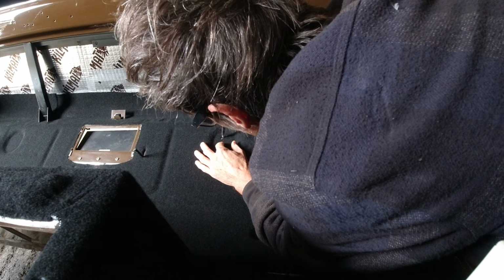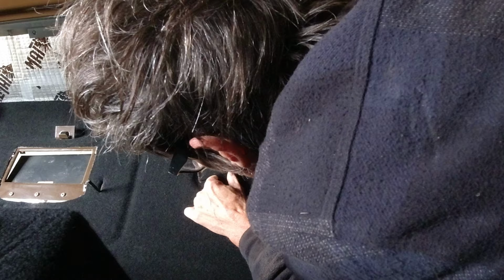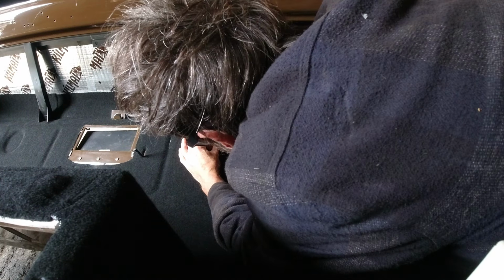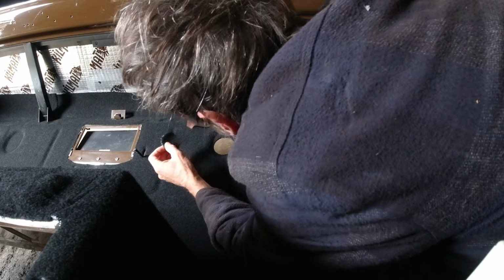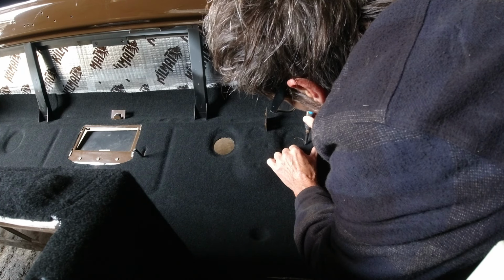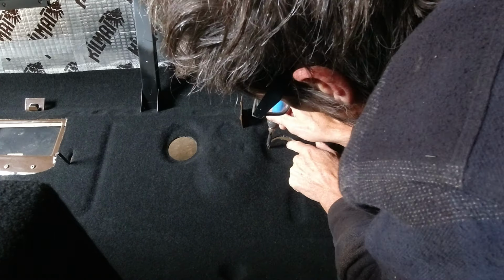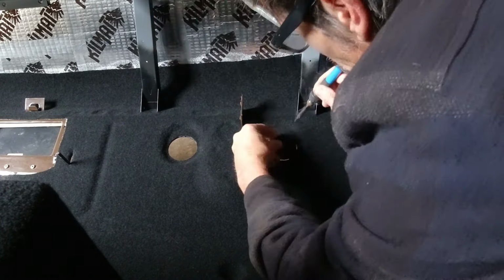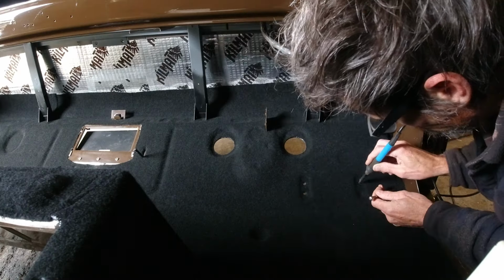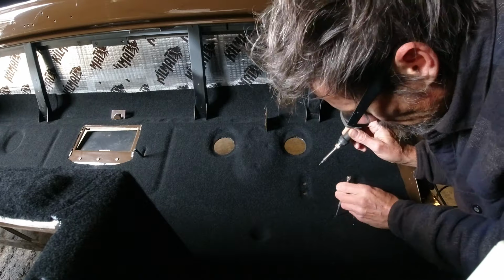After fitting the carpet so beautifully, the next thing was the rather counterintuitive job of putting a load of holes in it for all the pedals, cables and other gubbins to fit through. Watch carefully, there may or may not be an accident with this in the near future. We used a soldering iron for this, which worked beautifully at cutting out the lovely neat circles by melting through the carpet and leaving a nice tidy edge. Just don't drop it, Tim.